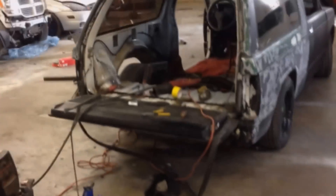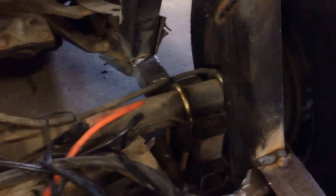What it do YouTube? Alright, this is where we're at on the S10 Blazer build. We got the C-notches tacked in, as you can see, across the top and across the bottom. Got the two-link in, which is down there at the bottom — you can see the U-bolts and the blocks are bolted down. The truck is still not laying on the ground with the frame cut out and the notches cut in. It should be on the ground.